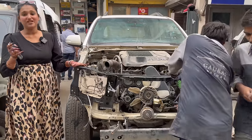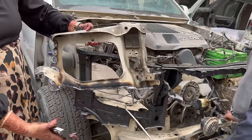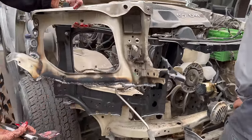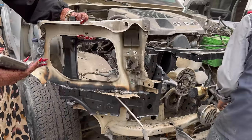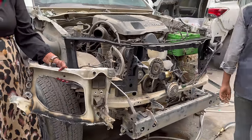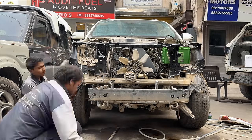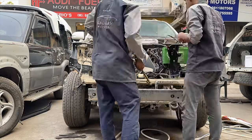The main reason to change the tie member is so that the headlamps and grill can fit properly. The old Fortuner's tie member shape is different — the headlamps' shape is different — whereas the Legender's shape is different. So the raw base needs to be prepared. You can see the old tie member cut part next to the new one and see how much difference there is in both shapes. Because the headlamp shape is different, we need to change the base so the new headlamps can fit properly.